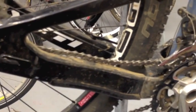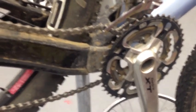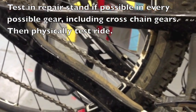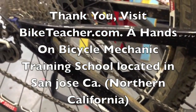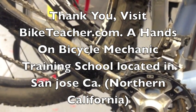Now go ahead and mount the chain back on the chain ring. Push down on the lower pulley towards the front of the bike so you've got a lot of chain slack — use that to grab the chain from the front and wrap it onto the smallest chain ring. Chain's mounted back onto the chain ring with good tension — we're good to go. You want to go through all your gears, shifting and test riding. Definitely before you go on any ride, make sure everything's good. Especially if you're working on somebody else's bike — test rides are always the last thing you're going to do after working on a bike.